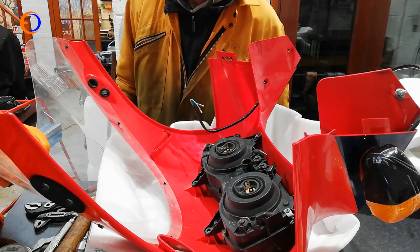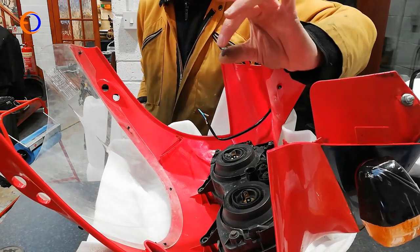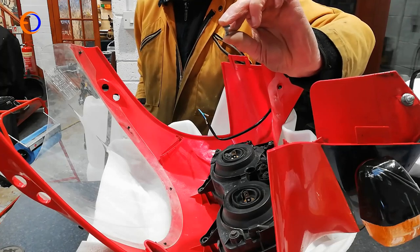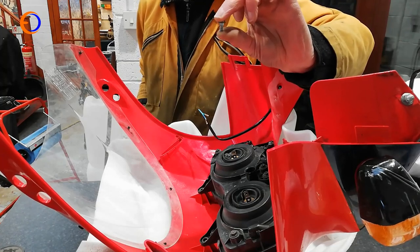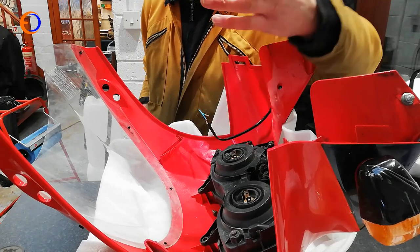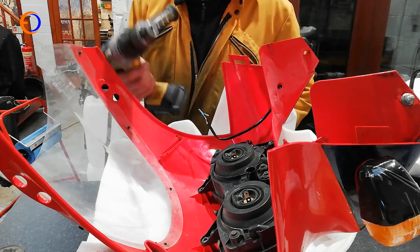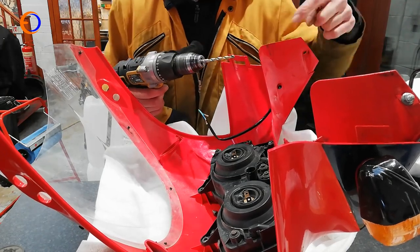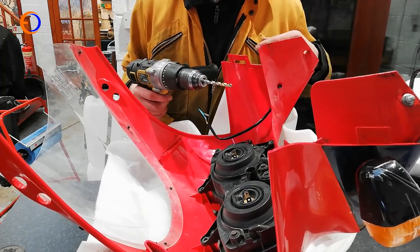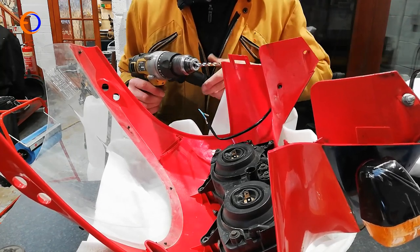That hurt — but it's fine. One of the bolts out of the other fasteners has a little shoulder on it. What we need to do is drill it — the head is six and a half millimetres, so a seven millimetre drill should take the head off but leave the rest of the bolt. Then we can just pull the headlight off and whatever's left inside is someone else's problem.